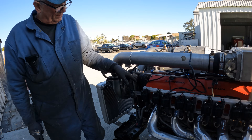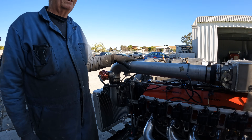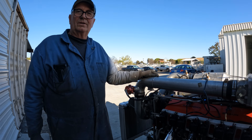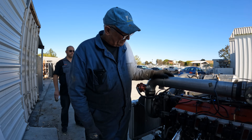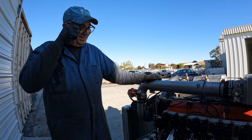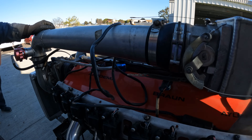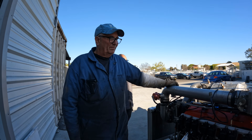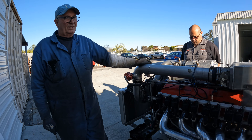I don't remember what the final ratio was — I think it's like 24 to one. But then we have adjustment with these pulleys here. This is kind of set up for full boost. We were actually going to run it on a dyno with an in-between size just to get the fuel curve right, and then go to these. You don't want to go full boost with the full pulleys right away. Kevin Ainsworth basically bought all the parts, and his partner Jeff Johnson was also involved.